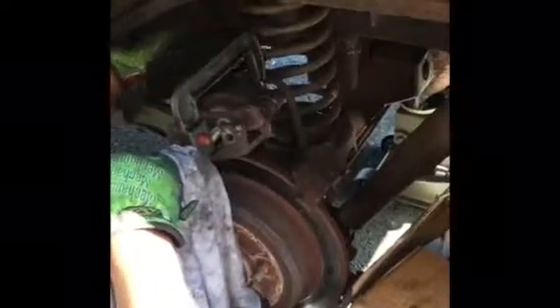Since I'm old-fashioned, in order to collapse this piston I'm going to use this brake pad. Set it up like such, just take a large C-clamp, get it situated, and start compressing it. Just so y'all know — the piston collapsed, so it's definitely due for a new caliper. Get that done with your caliper.